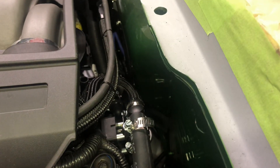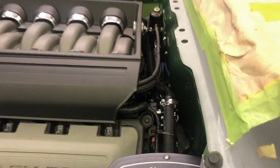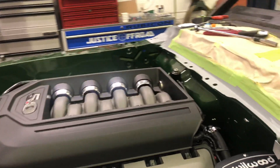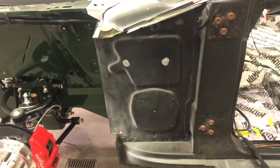When you have the heater core shut off, the coolant continues to bypass because the Coyote engine needs a constant flow through the system — you can't just have a single shutoff valve on one line. So you don't need to run the H-pipe in the system like you do on the Vintage Air setup, which saves a little bit of space.